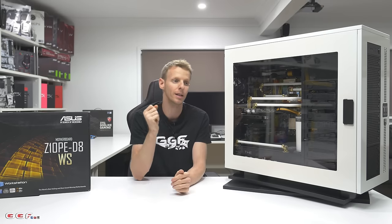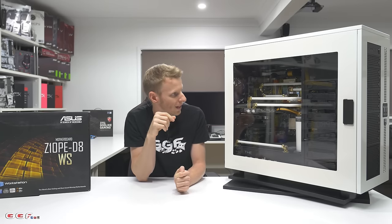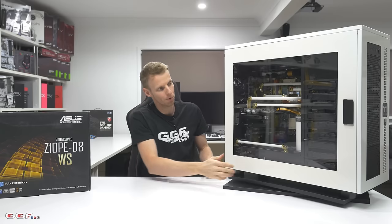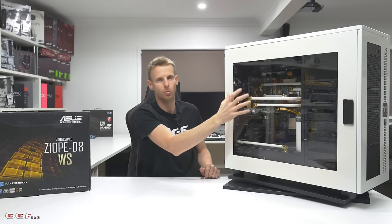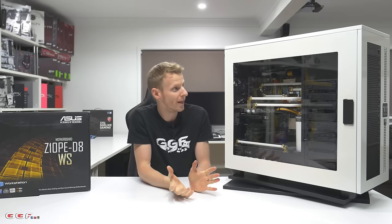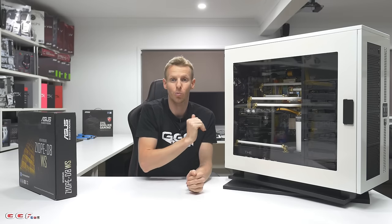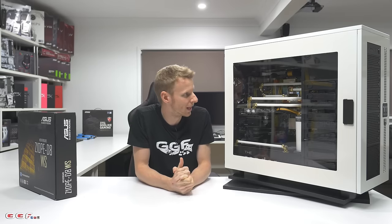The video card is a GTX 980 Ti from Asus. I've got the Bits Power block, and all the rest of the water cooling is Bits Power stuff as well, except for the radiator. Maximum room I could get was a 480 radiator in this case. Most people probably don't utilize all the hard drive bays, so you can put a radiator at the front — but I wanted to utilize all of those, so I needed a really good performing radiator to cool two CPUs and the video card. I opted for an AlphaCool Monster 480 — they're about 80mm thick, absolutely huge, and they perform really well. Even when rendering, these CPUs stay at 30 degrees Celsius, and I don't think I've seen the video card go over 35 degrees.